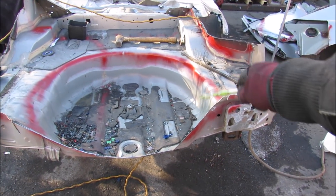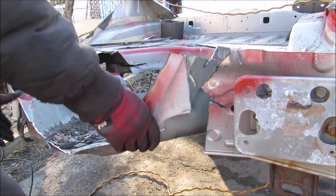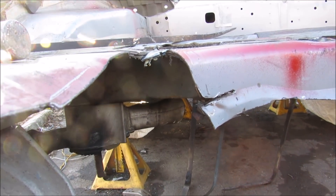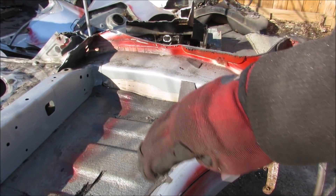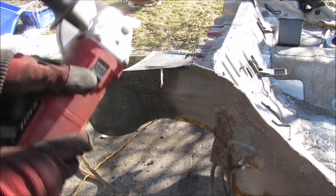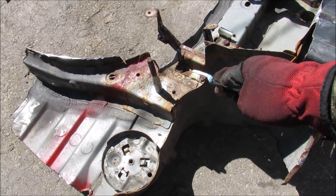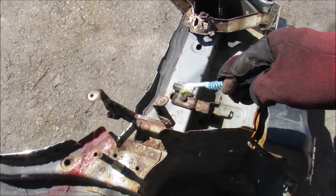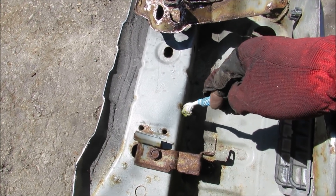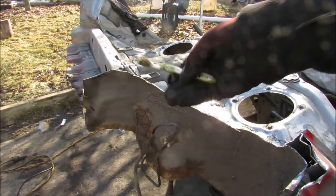With both quarter panels gone, I've got just the spare tire well to knock out, and then that will leave the two frame rails that come out the back. I ran into some issues with the front part of the spare tire well because there's a tubular structure underneath where the rear subframe mounts. Next I'm going to be chopping through this tube section above the rear subframe. Here we have the rear trunk part where the tube continues up along from the rear subframe, mounts to this bolt and the spring seat, and goes all the way along to the rear where the rebar mounts. There's a built-in crumple zone here with these divots that will crumple up in a rear-end collision, along with brackets for the EVAP system and the wheelhouse on the inside. And there we have the vehicle with no trunk.